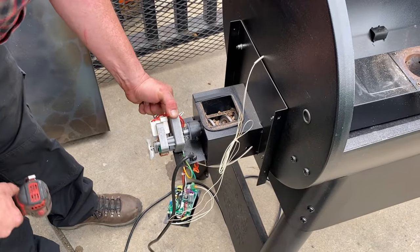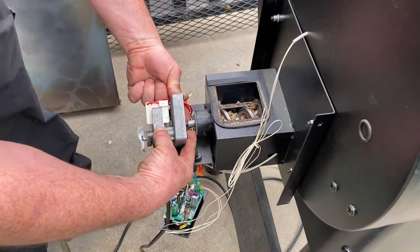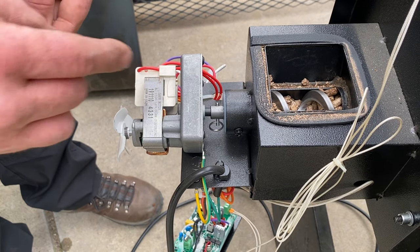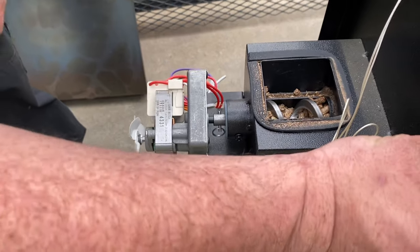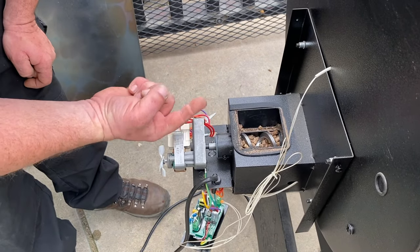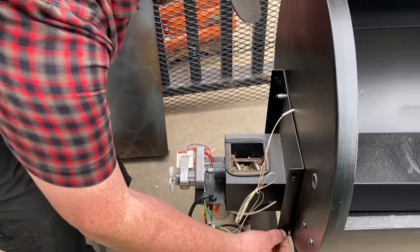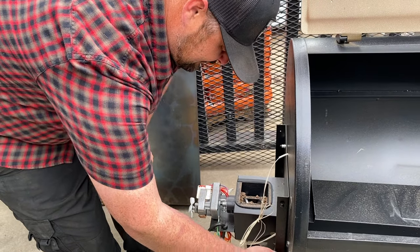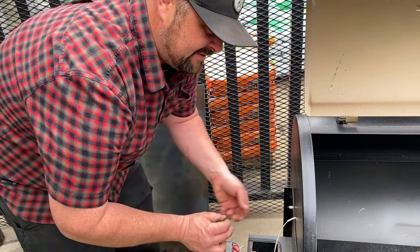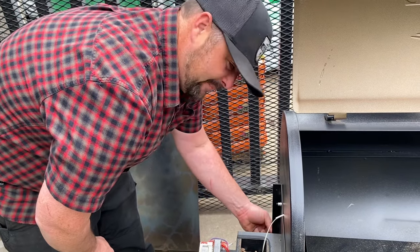At this point, this is where your auger is. You're either going to have this little screw pin right here, or you're going to have an Allen screw with a nylock nut — I prefer those over the pin method. Some of these pins will drop out; you may open this up and find that pin sitting on the shelf and the motor is spinning but not attached to the screw. I've been seeing a bit of that — some pins are just a little too small for the setup. If that's the case, get a 6-32 Allen screw, three-quarters of an inch long, and a little nylock nut for it, and it'll never be an issue again.